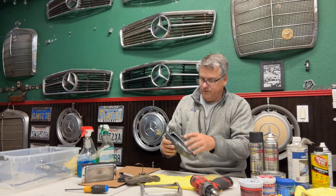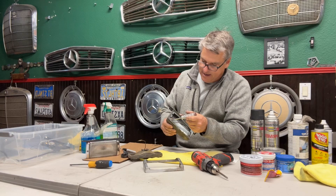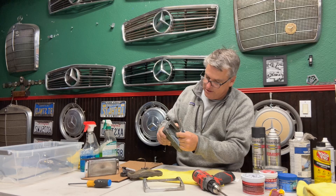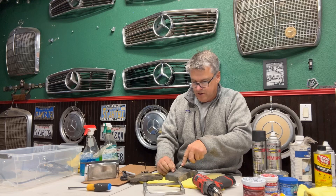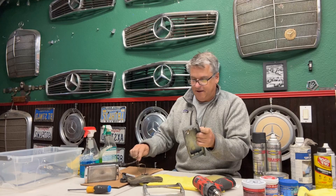But if you want to do the paint job right, you want to take this off. There's just a screw with this little nut on the back. Don't undo it all the way — you just need to do it a little or that nut's going to fall off, and it makes the job a little harder. Just a little bit, and that's just a ground. So now you're going to pull this out without damaging the rubber, and that's going to be hanging down from your car.